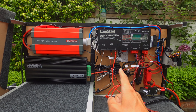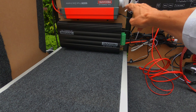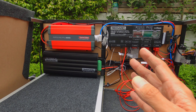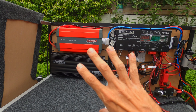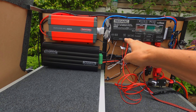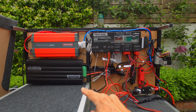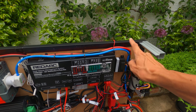This thing comes with two temperature sensors — I have one on the fridge which is down there, and then there's another one here. The reason I've got that there is I try to monitor the temperature of all of what's going on. When I had my old setup, everything was hidden away down this side and covered, and I was seeing some pretty high ambient temperatures of 28–30 degrees around all of this stuff. When this all goes together the sides will be open to allow more airflow and keep it a lot cooler. I monitor that through the second temperature gauge, and the other one goes into the bottom of the fridge.